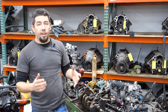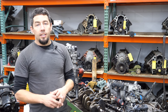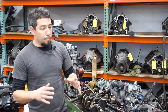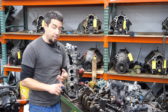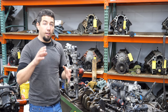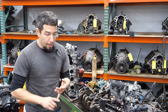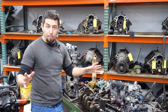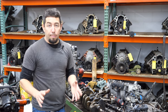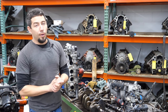I'm quite happy with the way this teardown went — it went extremely smooth with the exception of the dipstick tube, those things always seem to get me. This engine was an absolute mess — it had a little bit of every problem I see on these engines: tons of slack in the timing system, damage on the valve cover from the chain making contact, a little bit of bearing wear, valve damage, and a burn spot on the block.